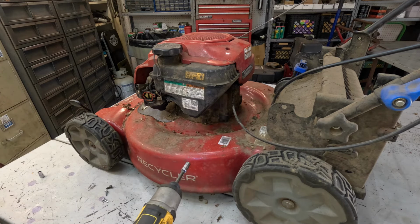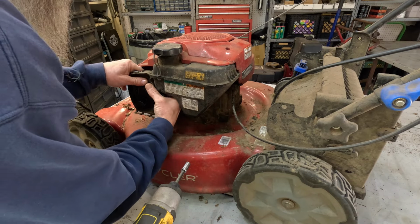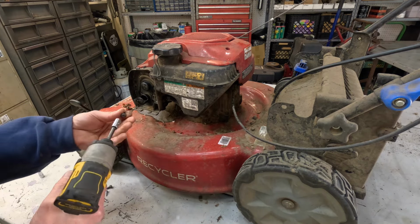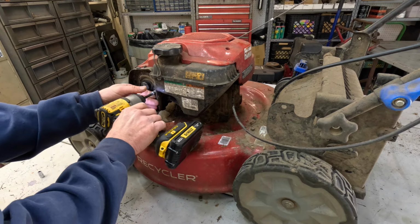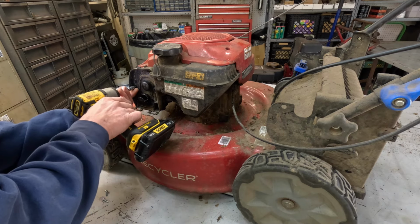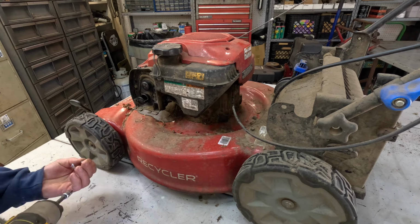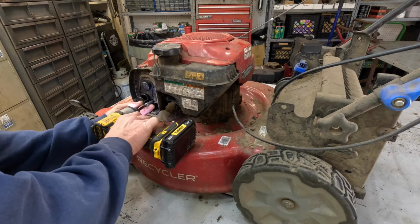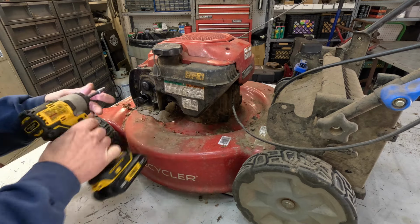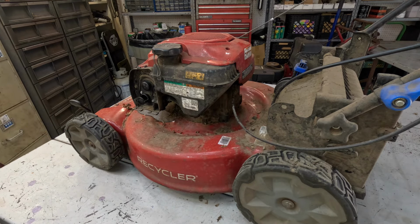Well, put the cover back on first. Can't believe y'all didn't warn me about that. Make sure the vent hose goes back on all the way. These two 8mm screws go on the outside. They go into metal. And then the two 7mm that go on the inside right there, they're going into plastic in the carburetor. And be very gentle. We're going into plastic. Good. When I go into plastic, I try to stop before this thing pops. That way I know it's not over tight.